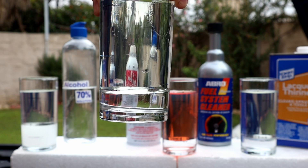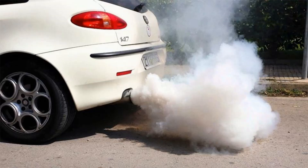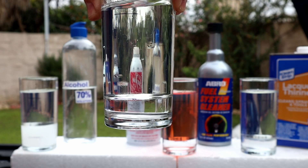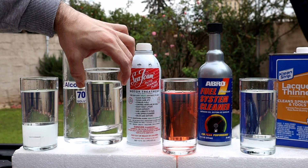Hello! Water in fuel causes many problems like check engine light, misfiring, and corrosion in the fuel tank if it's metal. Since water and fuel do not mix with each other and the water density is more than the fuel, the water rests at the bottom of the fuel tank and it will be suctioned by the fuel pump before gasoline.